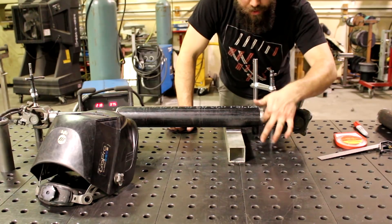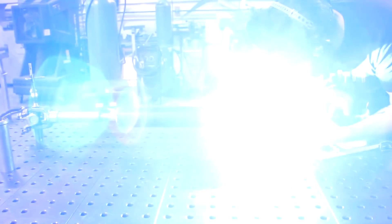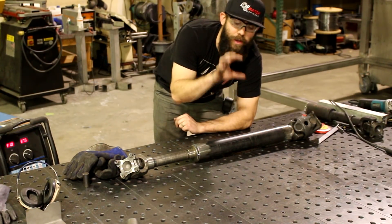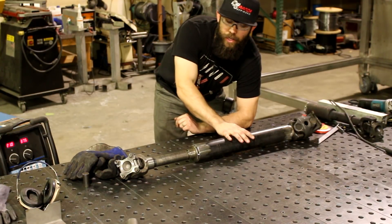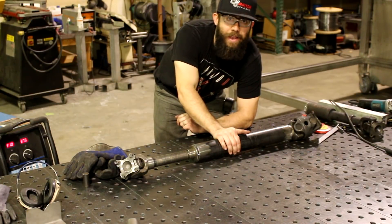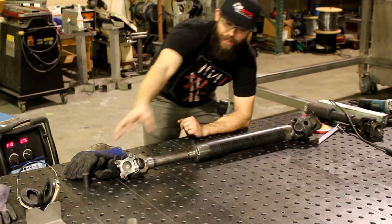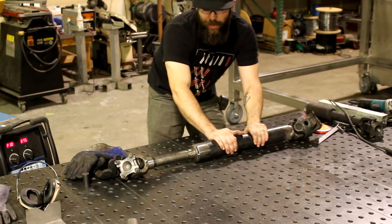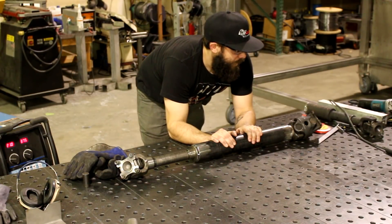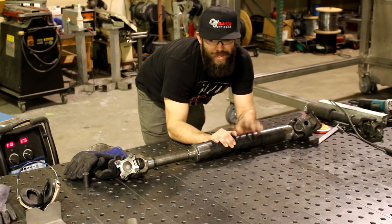So what we're going to do now is throw on the additional three tacks. It's important to note that at this step, if you're not 100% sure, you should take this driveline and put it in your rig and make sure everything's good. I have double, triple, quadruple-checked my numbers and I've had this piece bolted in holding this in position four times, so I knew where everything was going to be. If you're not certain, throw it under your rig — because once you weld it up, it's going to be tough.